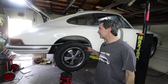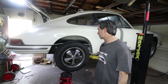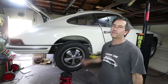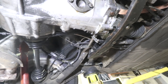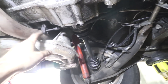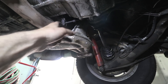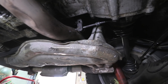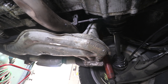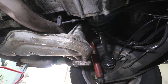I've already adjusted the throttle linkage and the clutch, so the clutch is working. To test clutch engagement it should not grind at all in reverse, and I'm able to get that done. I did have to shorten the clutch cable a little bit because on the stock 3.2 exhaust it runs right in front of the clutch adjuster. The clutch cable runs alongside the transmission and is held captive by a little boss in the side cover - this is the clutch arm, what the clutch cable pulls against. If I hadn't cut the cable it would have run right into the exhaust. So I cut it and it's just barely got some clearance there. I'm almost out of adjustment on the cable, which is not ideal - there's some adjustment at the pedal box but I didn't want to rip into that right now. This does work, it will engage reverse without grinding, so I think we're ready to take it for a ride.